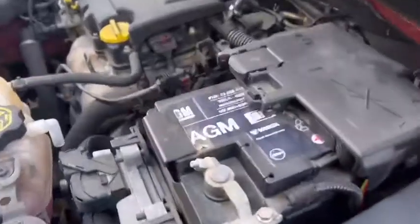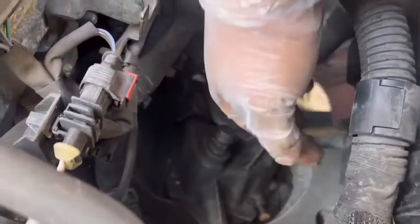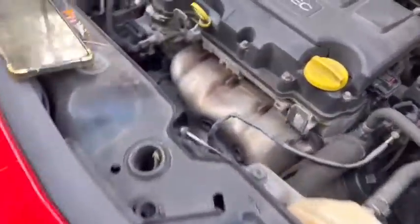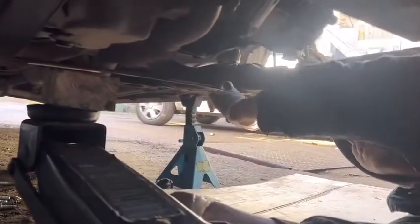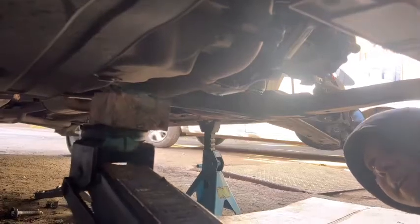And also this battery, I think I don't want to remove it because I have clear access to the engine top mount. We'll see how it goes. First of all, I'm going to do the jack support for the sump area. I'll show you. And I'll give a wooden piece support. And also, I'm going to remove this bracket because it covers my way.